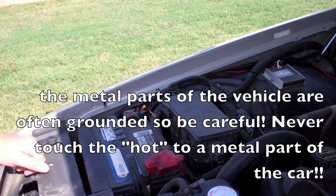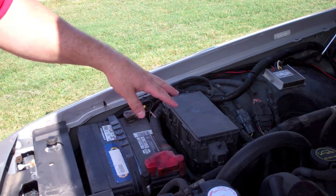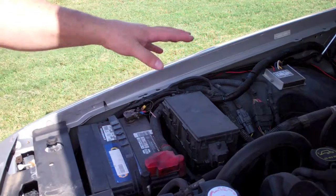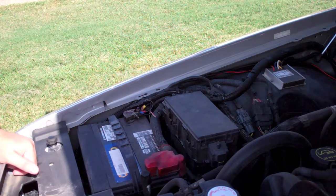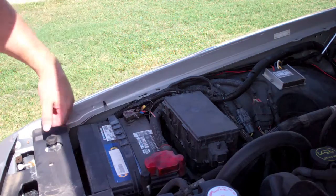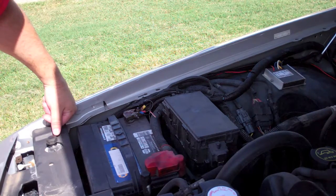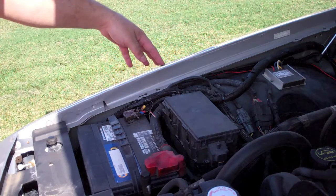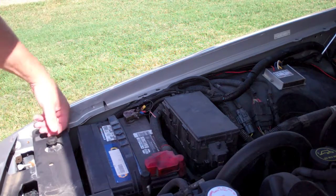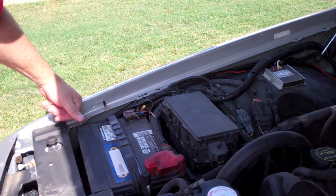The way vehicles are typically wired, the hot side of the battery is wired into one or more fuse blocks, and then power goes off of there. That way, if something pops, touches ground, or pulls more power than expected, it will pop the fuse instead of blowing up your battery. This particular police car has some aftermarket wiring added — cut wires when they sold it to me. I generally prefer to wire off of the fuse block or a different ground source rather than directly on the battery. It's not necessarily wrong, it just looks sloppy.